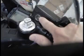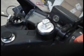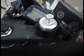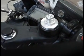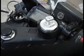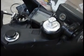As far as front brake fluid reservoirs go, there's the front brake fluid reservoir, and you can see that the color is pretty much perfectly clear. When that fluid starts to look really golden brown, it's probably time to flush the brake fluid and change it out, because it should be perfectly clear. After that is chassis and chain.